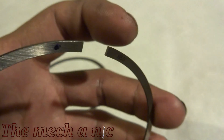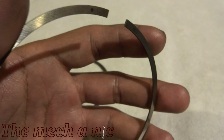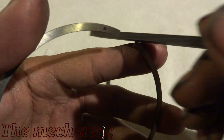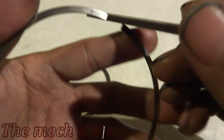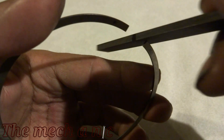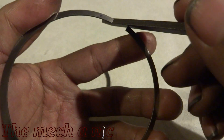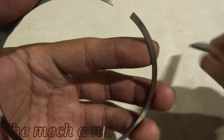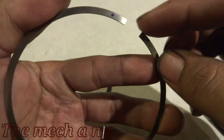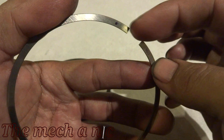What's happening is these ring corners are so sharp that they're cutting into the walls. All I have here is my file and I want to create just a very slight bevel to get rid of this sharp edge — on both sides, just knocking that edge off. Remember, you're not trying to change the gap of the ring; just getting rid of this very sharp edge. Once I was done doing that to all four cylinders, I put everything back together.